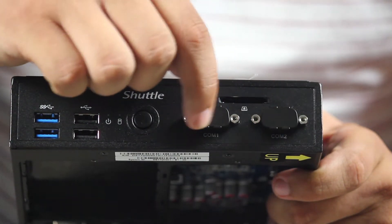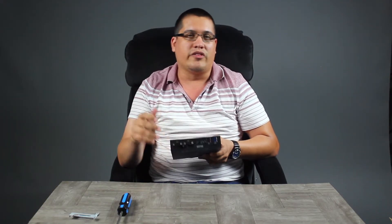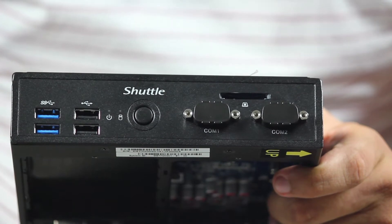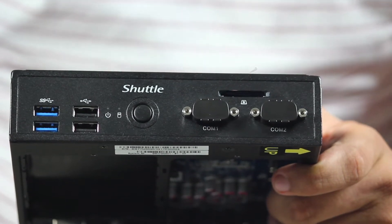Let's go ahead and break down the unit. Here in the front, the RS-232s I mentioned — for your legacy devices, we got you covered. SD card reader, so if you need additional storage via an SD card, pop it in there. You got the always-important power button — you kind of need that to turn the unit on — and LED indicator lights: one for general power on the unit and one for hard drive activity, very helpful for troubleshooting. Furthermore, you got four USBs here — two 3.0s, two 2.0s — for any devices that require USB connectivity: keyboard, mice, printers, etc.